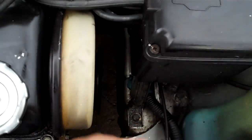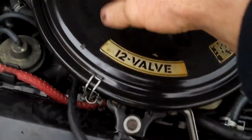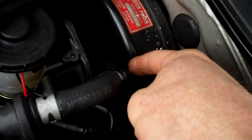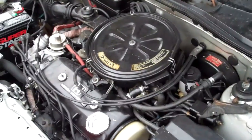There's the cover I was telling you about. To get this off you have to take that off, and to take that off you have to take the other off to get to the bolts that hold it down. It gets to be a lot of work. This car is not worth a lot of money, and they already spent money putting in the new master cylinder because it was leaking into the brake booster — this is where the fluid was going up into the intake and creating such havoc.